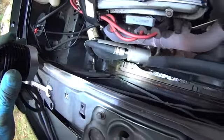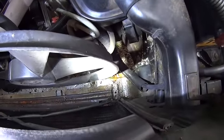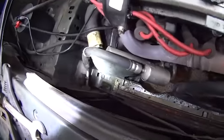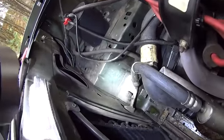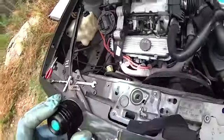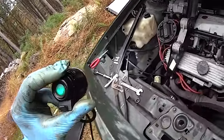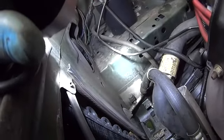I have to clean it up — there's a lot of gunk in there. What I'm going to do is clean it up really clean and put that thick sticky wax all over. Because this radiator support is not actually bolted on — it's actually welded to the frame. Usually the radiator support is a separate part that you bolt onto the frame or the body of the car, but in this case the radiator support is spot welded right on.